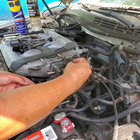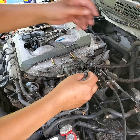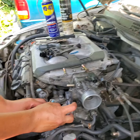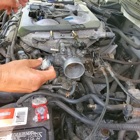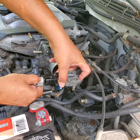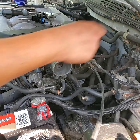You must disconnect the electronic wire here, and then disconnect the electronic wire to this idle controller valve. There are two — one top and one bottom. And then another one underneath that goes to the idle controller valve itself. So disconnect that — one, two, three wires total.